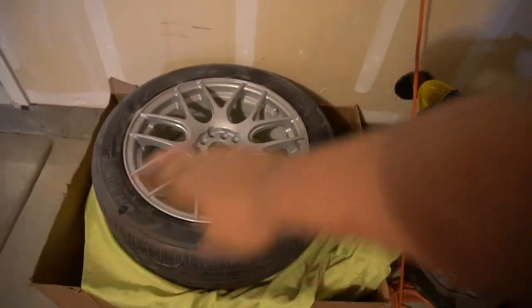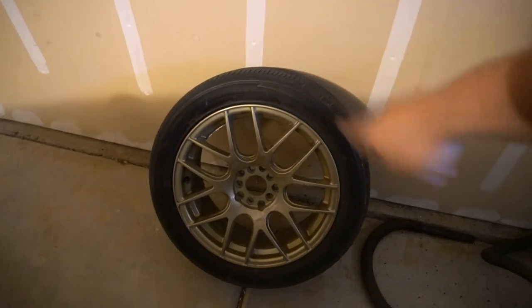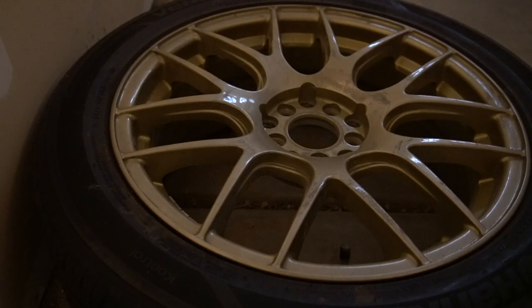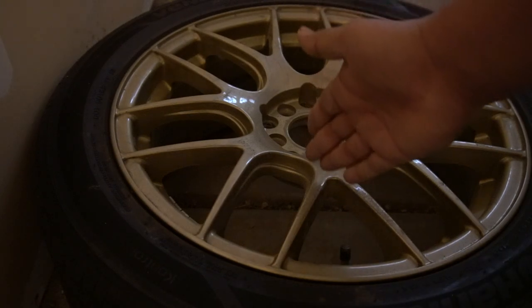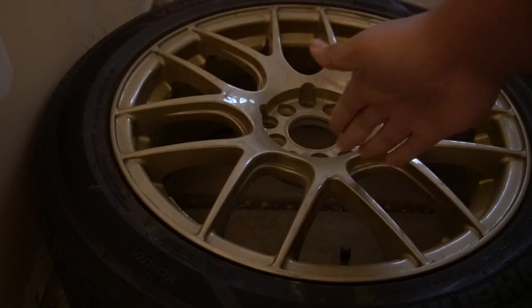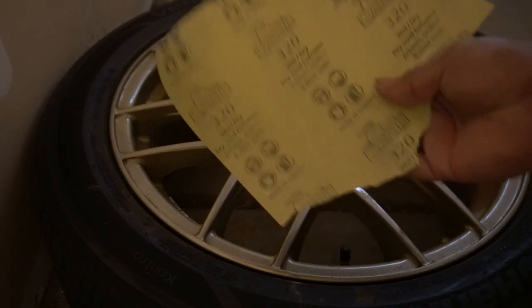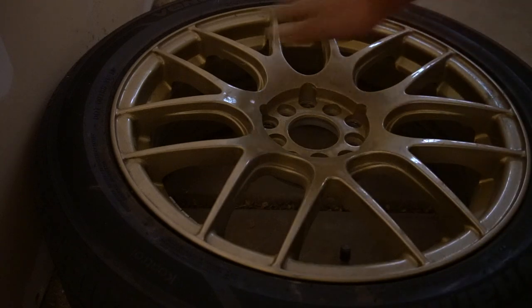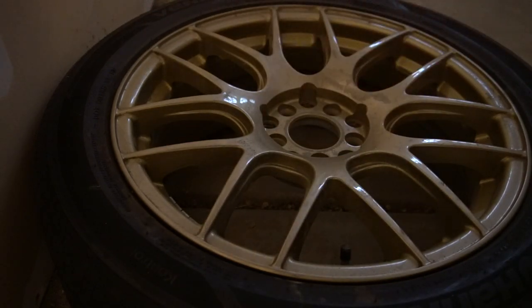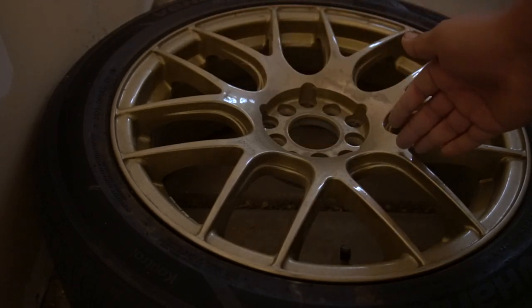Today I'm going to show how to get the best results that I found on these wheels. Like I said, I am no professional — this was a learning experience for me too. Alright, we have the wheel right here. It's pretty clean just from having it in my parents' garage. So first thing I'm going to do is get some 320 grit sandpaper and go ahead and start sanding the whole surface area to get it ready for primer. And after that, before we prime it, I'm going to go ahead and wipe it with some alcohol and some shop towels.